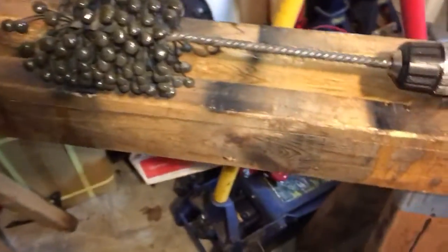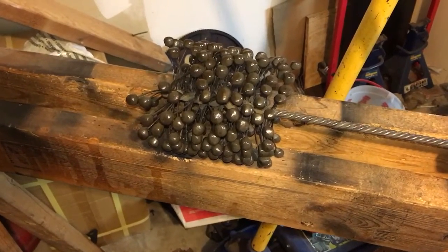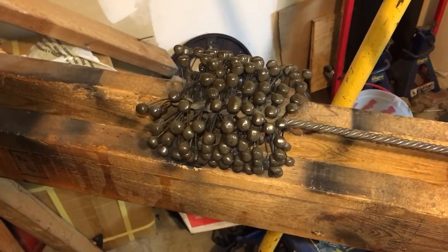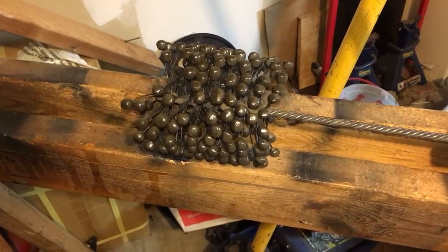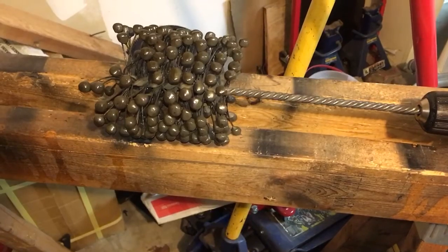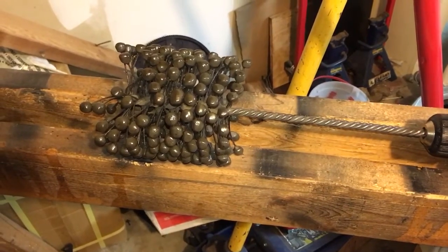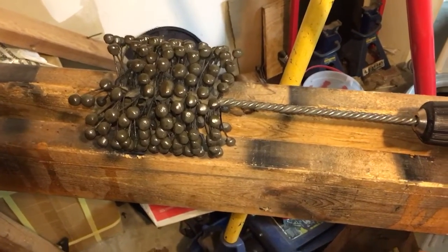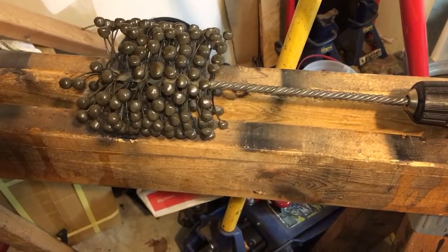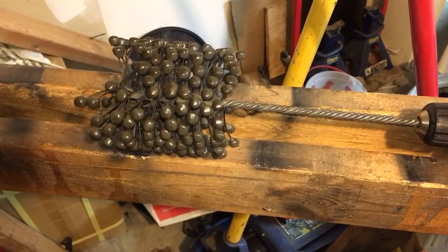From experience, when you look at these flex hone tools mounted on the Ryobi, as the flex hone tool starts to wear in and kind of go through its cycle of life, it'll start getting real flat on the end of the dingleberries. Don't let that deter you from using that tool, because the little pieces that the dingleberries are attached to are actually nylon. A lot of people mistake that for just metal wire and they're afraid that when that nylon starts showing through the dingleberry it's going to scratch the crap out of their cylinder, but it doesn't because it's just nylon.